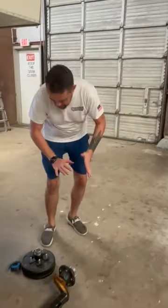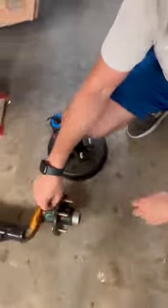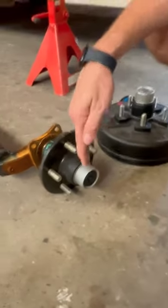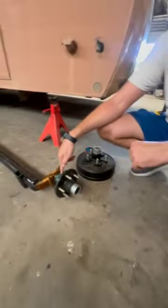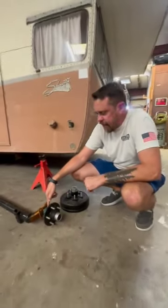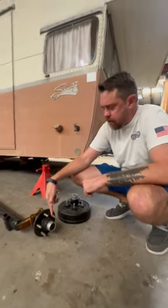The one last thing I want to talk about is easy lubes. So, these newer axles that we are buying have an easy lube system, which means the spindle is drilled and it allows grease to go front to back. Also, the seal in these for the easy lube is a lot thicker. So what it does, it takes the grease when you pump it in the zerk there, all the way to the back,